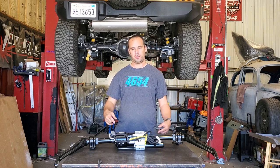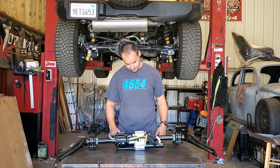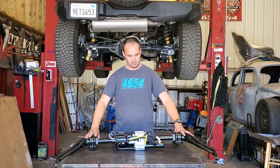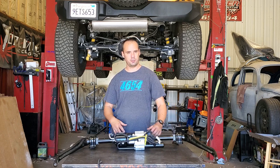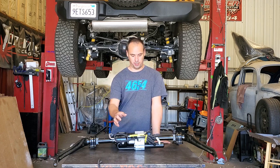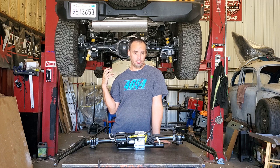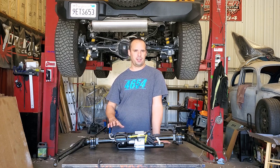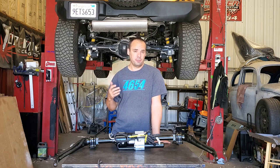So I went online, found the part — I'll put the part number in the description. I've done a fair amount of research. What I do know is you don't need anything extra to run this thing. It's fully self-contained, not air-actuated like some other systems where you need an air compressor or pump — it's all electronic, you just need power to the right ports. Wild Track doesn't have the programming in the computer for it, and it also doesn't have the button on the dash. There may be ways to add the button and do the computer programming to make it think it's a Badlands, but that's not my plan.